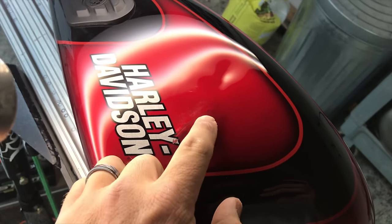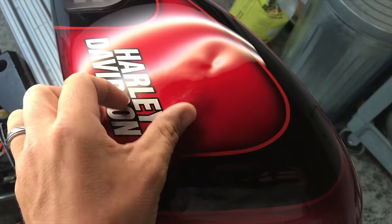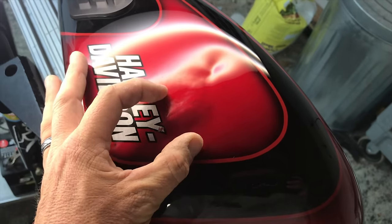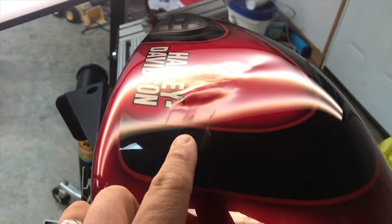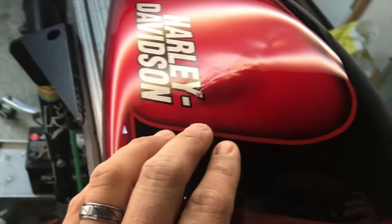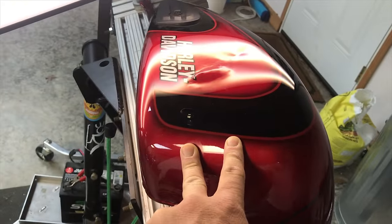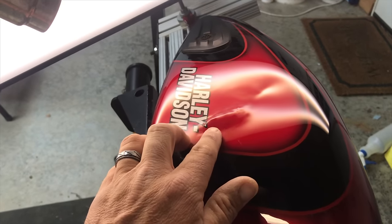As you can tell from the time lapse, I got to a point where I just could not get that deep crease to come out. There's a little poke mark and still a faint line where the crease was — the metal was severely stretched in the center. When that happens, the surrounding metal can't absorb that stretch, and as you try to push it, it turns into a mound sticking up with dented metal around it. It took a lot of heat, and I know it looks terrible at this point.